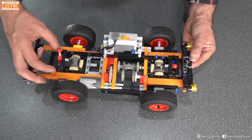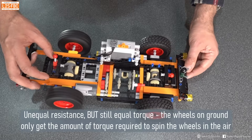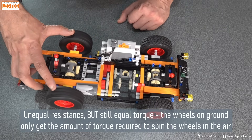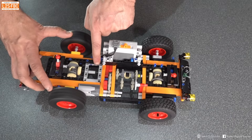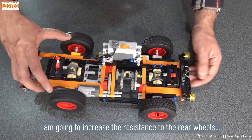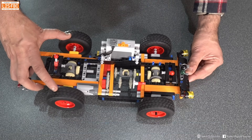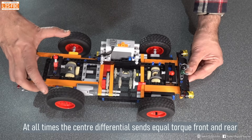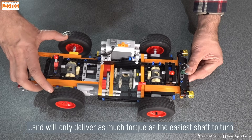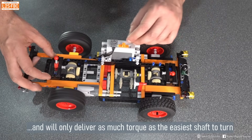Here's another demonstration of that principle: vehicle in the air at the moment — equal resistance front and rear. Put it on the ground — less resistance here, torque equalisation. Now if I make this back axle harder to turn, more force is going to be required to turn this shaft, and that means more torque is going to be transmitted to the front wheel. You can see the front wheel starting to spin. When I take my fingers off, that stops — and that's effectively how brake traction control works across an axle — that's your force equalisation in an open differential.